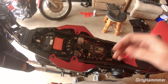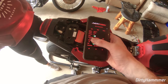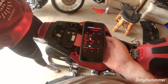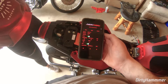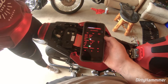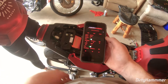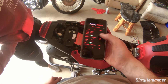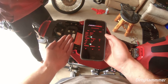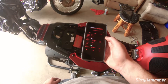Now connect to the app and verify the settings. I'm going to leave the sensitivity, kill time, and RFX all stock for now — once I ride it I might adjust them. The important setting is push versus pull: if your bike is set up with a MotoGP-style shifter where you push down to shift up, select push. If it's a stock normal setup where you pull up the lever to shift up, select pull. I'm disabling push and keeping pull enabled.